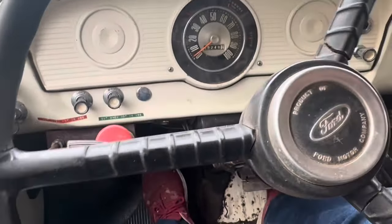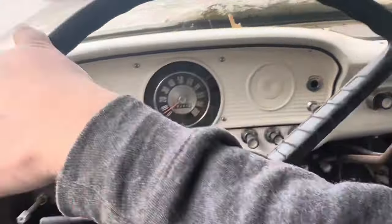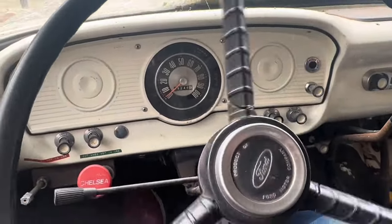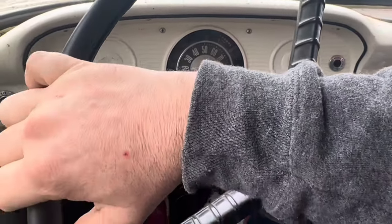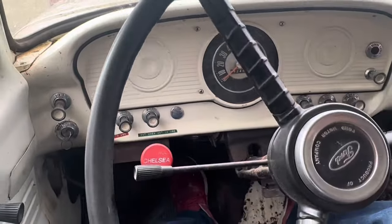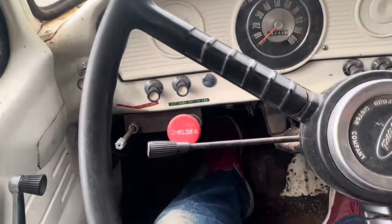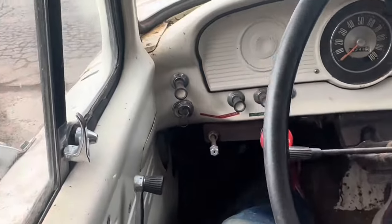Fired right up. So I thought this was a 4-speed transmission. It's actually a Clark 5-speed, which just means that the 5th speed is direct drive and number 1 is really low, for like pulling off a farmer's field or, you know, just real low.